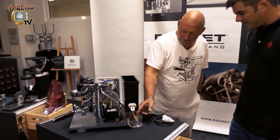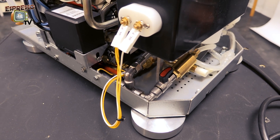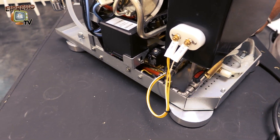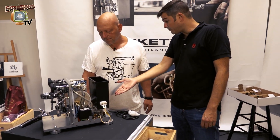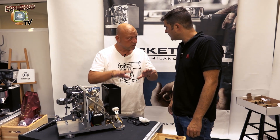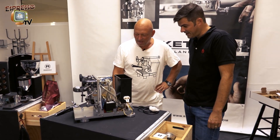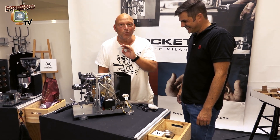This is also a cool adjustment system. We brought this technology from the Type V in order to have the pressure on the coffee cake at around 9 bar. That's why we have the expansion in this position — to allow a better result. When you set it, you close the tap, set the expansion, then open it again, and the machine is at about 9 bar. We have to remember it's a vibration pump machine, so we need this help for more stability during extraction. A vibration pump is not super stable — it comes out with a little more variation and not so constantly, which is the limit of this component compared to a rotary pump. For all the components put together it's a really super cool solution. That's innovation.